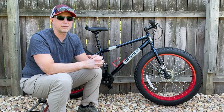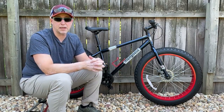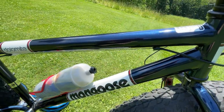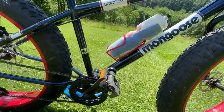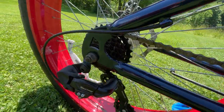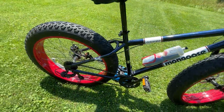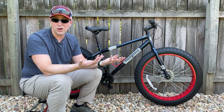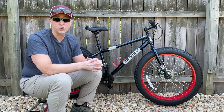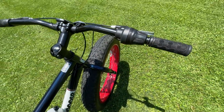Before we talk about the ride impressions, let's give a quick overview on the basic specs and features. It is a steel frame bike — I'm not sure what the alloy is, but it's certainly a lower-end alloy based on the price point. I'm actually quite impressed with the looks of the bike; it's pretty sharp looking in my opinion. The welds are a little bit rough, but nothing to be concerned about. The drivetrain is a 1x7. Although it is very simple, it has very limited range, which is one of the major shortcomings of the bike. The crankset appears to be a no-name with no branding on it at all. However, the grip shifter and the derailleur are Shimano Tourney. I've never really been a fan of grip shifters as they can be difficult to modulate, but I'll talk about that in more detail in the ride section.